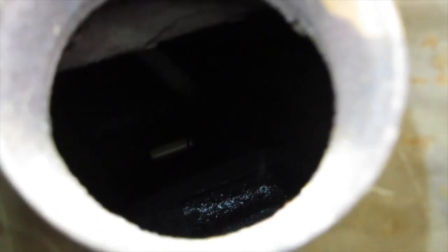That thing is grungy. Anyway, guys, I'm going to clean up now. That turned into a big pain in the butt, but now I know for sure that the fuel tank can be pulled out of a Volkswagen bus with a 2.0, this is a 79 model, without pulling the engine. Had to loosen the engine bolts to drop the engine, but it only dropped maybe an eighth of an inch. I think the big thing was that the coil was hanging me up.